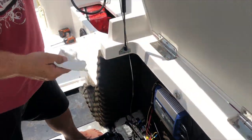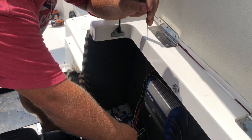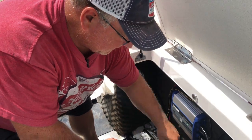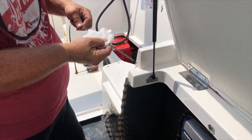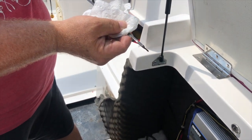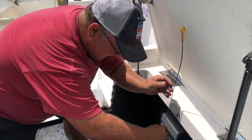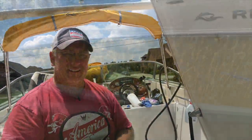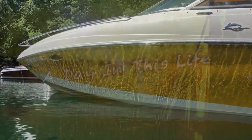Last thing to do is check the oil. Picking up where we left off before my microphone decided to completely die — the last thing I needed to do was check the oil. You should always check the oil even if you know exactly how much oil goes into your motor, just to be sure there wasn't something remaining and you don't want to have an overfill issue. You can see I'm checking the dipstick, and for those of you with eagle eyes you'll notice the oil level is reading high — and that's okay, simply because there's no oil in the oil filter yet. We haven't run the motor, so once we get this thing buttoned up and get it out to the lake, we'll run the motor, get it hot, the oil filter will fill up with oil and we will be good to go. Thanks for watching — I hope you found this helpful. Give it a thumbs up, maybe consider subscribing, and in the meantime get out there and enjoy the lake. Happy boating — we'll see you on the next video.